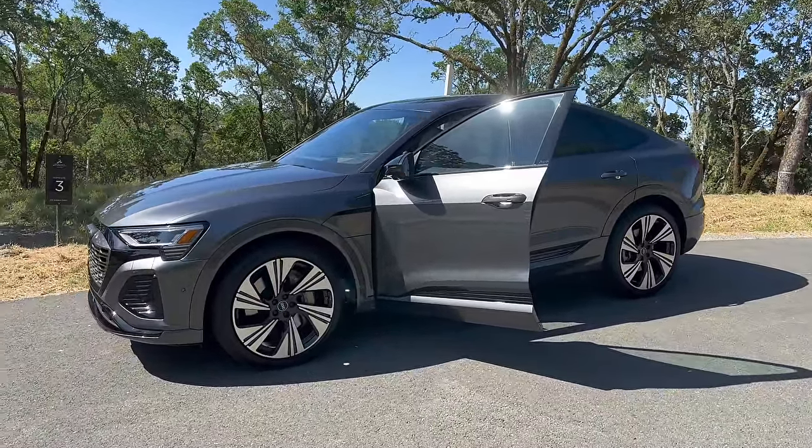And so I'm really excited to see now that they've upped the improvement and that we have the sport summer. Well, we have the summer tires on the 22-inch wheels. We should have maybe a little bit better turn-in response. The steering ratio has been shrunk now, so you don't have to yank the wheel around so much. It's got more presence on center. In our car, we actually have to put a lot of steering input in on center. Here, wow, night and day difference on the steering immediately, I can tell you that. Now, is that a good thing or is that a bad thing? These are the things we'll have to find out.